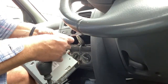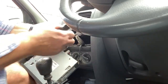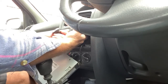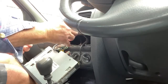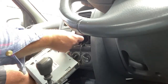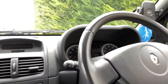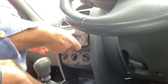That's as simple as that. To put it in place permanently, just pull it out, fiddle the switch through the hole, then connect the switch up the right way around and push it in. Double check — lights coming on here, lights coming on the dash, turn it off, lights are off there, lights are off on the dash. That should be it fixed. Then all you do is put the radio back in and that's it.